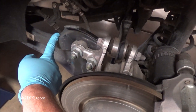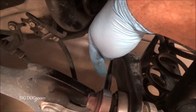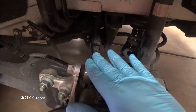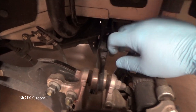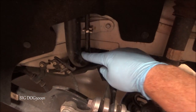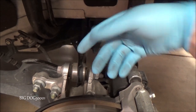Now that we've got the rear wheel off, here's a little orientation. We have our rear trailing arm, and this is our upper control arm in the rear — this is the bent part we're replacing. Below that is our lower control arm A, and over here is lower control arm B as in bravo. Then we have our shock and our spring. If you're going to do the other side, it's exactly the same part just turned around. There's a sticker that tells us which way goes to the inside. The only difference on the other side is the filler neck gets in the way.